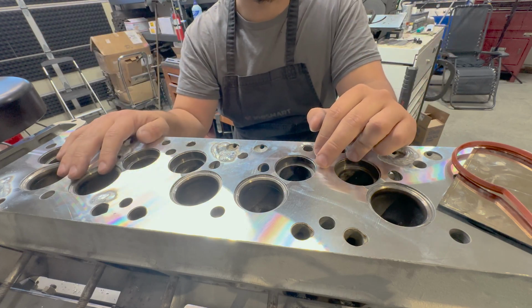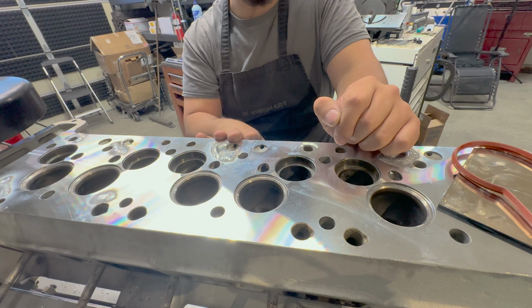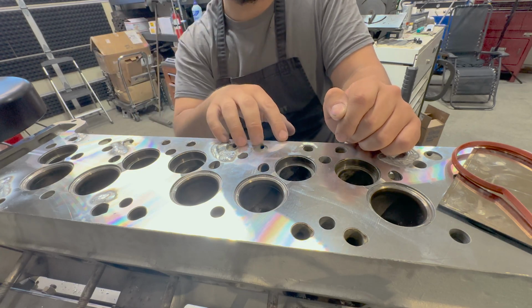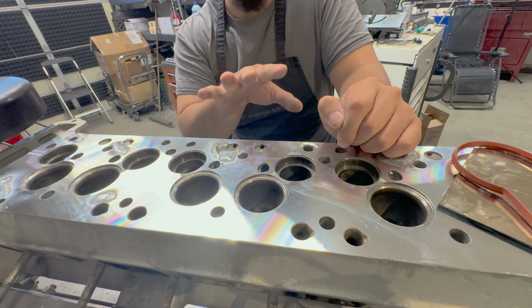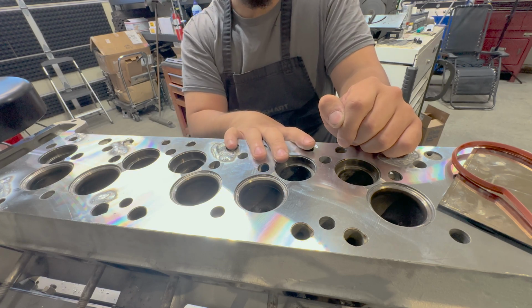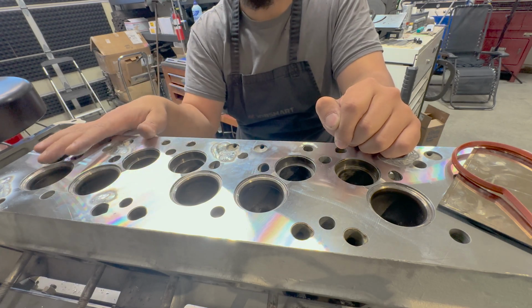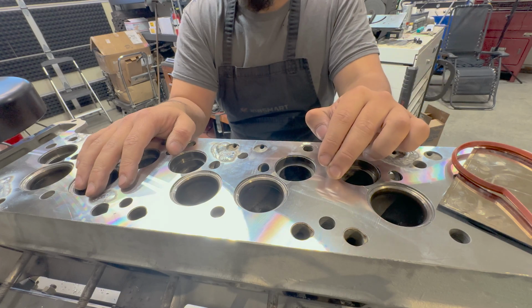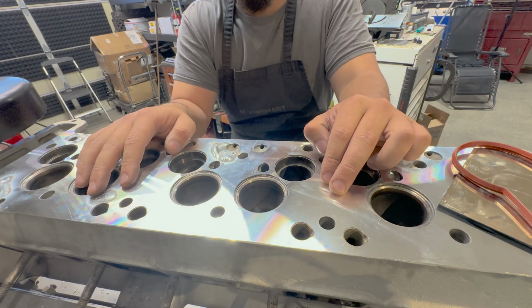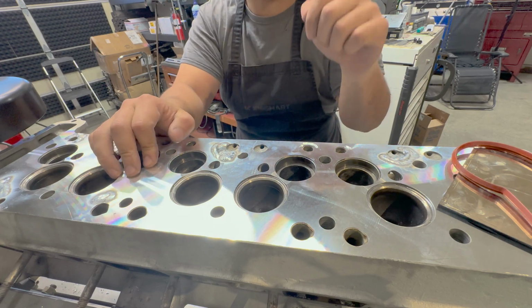He said, hey, let me tell you something about this. So he walks me through and he says, hey, change your tungsten. This is what you're going to want to do. You're going to have to blast a bunch of amperage into the head, puddle up that base material, and then you can add in your filler rod. But I also built upon that, changed the tungsten, and came back in and hooked up my helium tank.